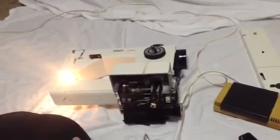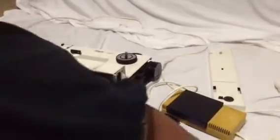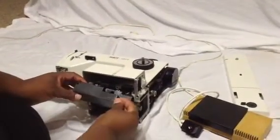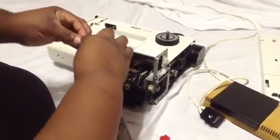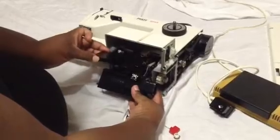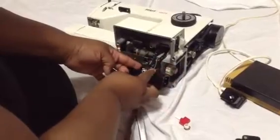I hope this was helpful. Just doing a quick review — let me unplug this for safety purposes. To get into my machine: I unsnapped the lid, took the one screw off and took the side off, and I took the heavy bottom off by five screws. Then I pulled this off with the two screws, pulled it out, turned it around. The lid on this was held by one screw and sticky glue, so you're going to have to give it a nice little tug. My husband pulled it because it was sticky.